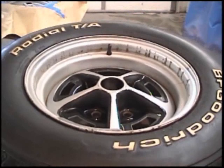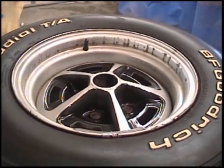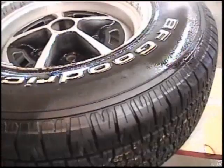We're going to start on one of the wheels. First thing you need to do is prep the wheel — whoever owned the vehicle before may have had tire dressing or silicone from Armor All on it. That stuff will definitely cause fish eyes and you do not want fish eyes in your paint, because then you'll have to start over. Take the brake cleaner and spray the whole wheel down — it comes out pretty fast. That's going to help get brake dust out and any type of tire dressing. Let it soak a few minutes, then take a rag and wipe it out.